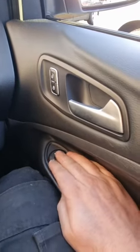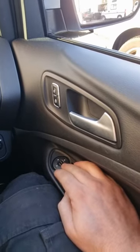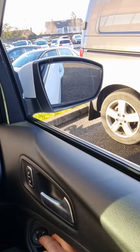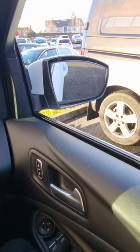Put your mirror adjustment over to the driver's side, same thing for the passenger side. What you want to do is tip the mirror right the way down, as far as it will go. And that will give you a gap at the top of the mirror, which should allow you access to get at the bolt.